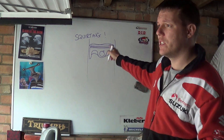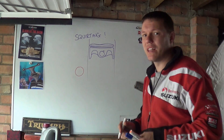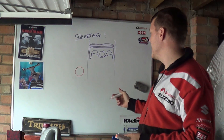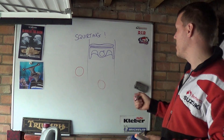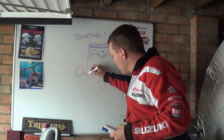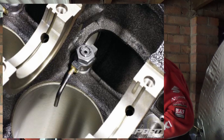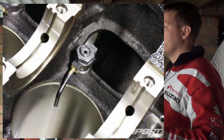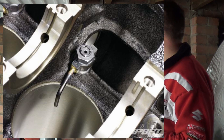Well generally what happens is you have your piston and your conrod and all that, and then you have your main gallery feed — this is the main gallery feed. It can be there, it can be here in the actual block, it can be wherever you want. Generally off your main gallery you'll see there's a hole and then there's a little oil jet squirter thing with a little thread on. Sometimes they're crimped at the end, sometimes they have an orifice at the end.